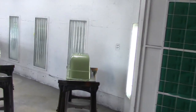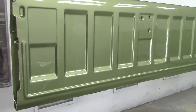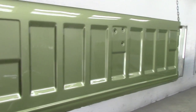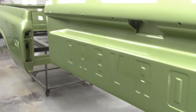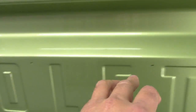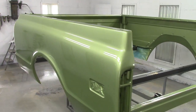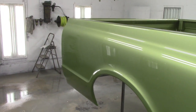the bottom is green. So here we go — let's aim for the tailgate first, because usually on tailgates you always seem to get a sag or a run. Nothing on the backside, nothing on the front side. A common place on tailgates is in these letters — you'll tend to get a little sag sometimes, because you're always trying to lay that clear down just perfect.